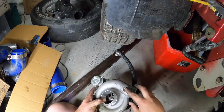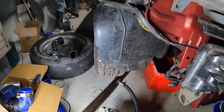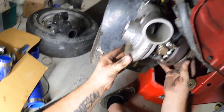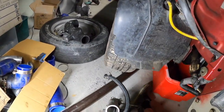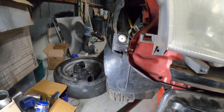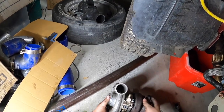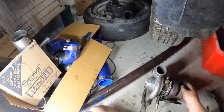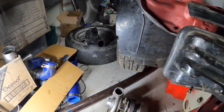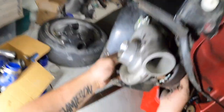So obviously while it's out, I'm going to repair this up. Probably just weld that up a bit, clean it up, weld it up, make sure it's good. So this will be up nice and high. Yeah. Might take this water line off. Probably use both on this side. Makes sense, yeah. So I'll get that one off there, seal that up with this one here, and yeah. I'll probably change the oil drain to a 10AN, and we'll just run it straight across. So yeah, that'll start up nice and high this time.